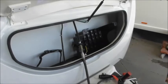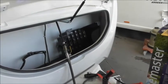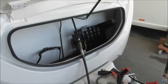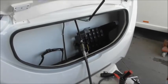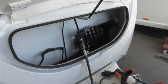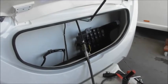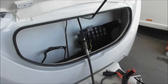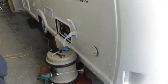Propane is a better gas for all year round; butane is more of a summer gas. Butane doesn't gas off in cold weather — once you get to zero temperatures it starts to struggle because it's a liquid in the bottle. Propane will gas off down to about minus 40, so unless you're caravanning at minus 40, propane is the better choice. I've turned the gas on — usually I do that so the wife can go inside and start making a cup of tea while I'm setting up.